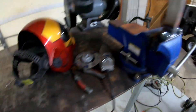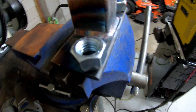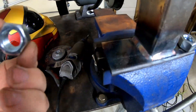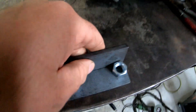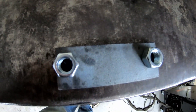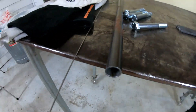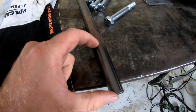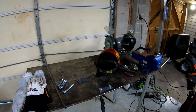Alright, here we are on Sunday — been to the store. Picked up the nuts and bolts that I want to use. I'm going to put those right there at the edge. Haven't welded anything yet — I've got to drill the holes, I'm going to mark everything. On the outside, to space it up so it's not hanging from underneath the car, I'll mark it from there and drill those holes. I also have this tube right here that I'm going to cut to the width of the actual rail, just to keep from crushing the frame rail from inside.